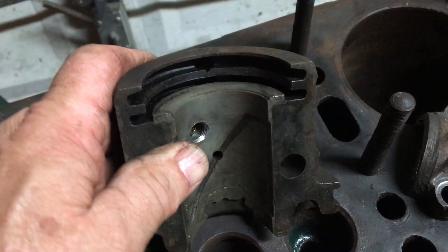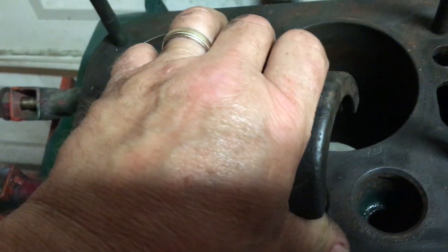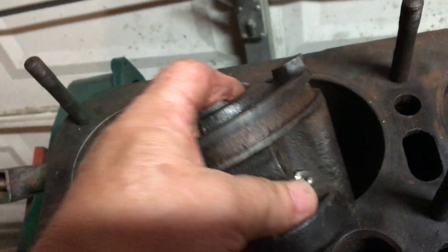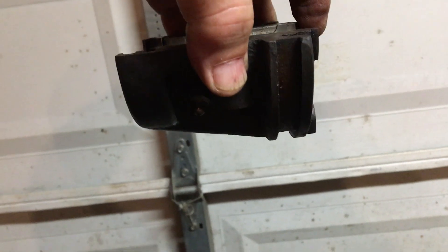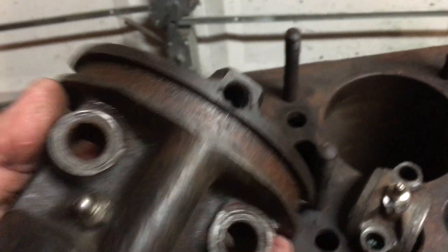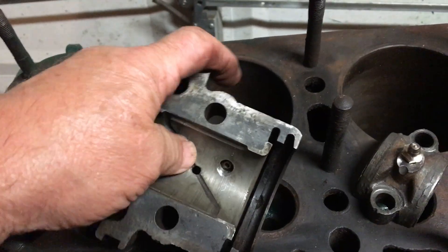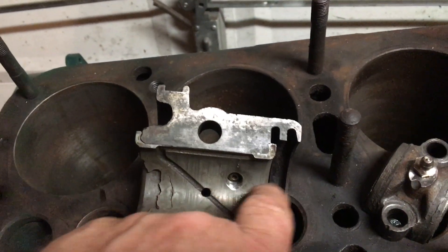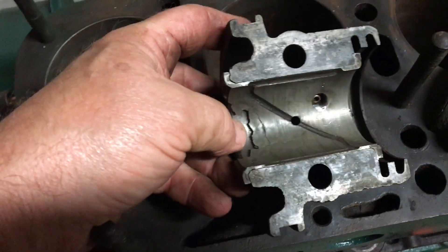That's the equivalent of a rear seal on the Model A. The extra oil goes in there. This thing is like upside down when it's mounted, so you can see the bottom is at an angle and the oil runs from this end down and into the back into the pan. I had to avoid that, otherwise if I pumped grease into that oil line it would just squeeze out the ends and it wouldn't get oil in here. As you can see, this is another one where the babbit is shot, no good.